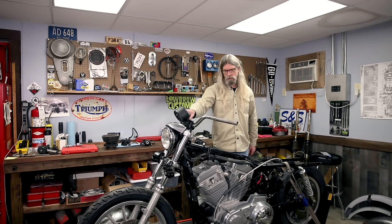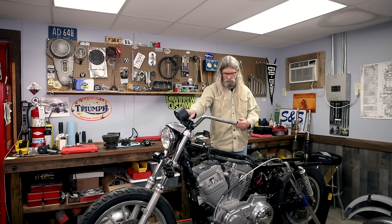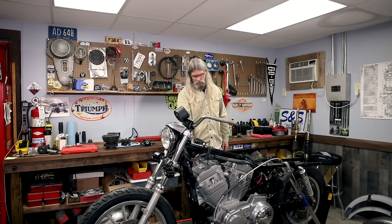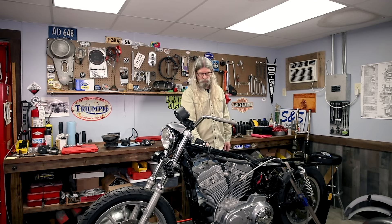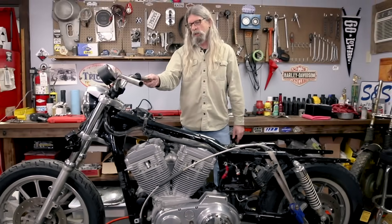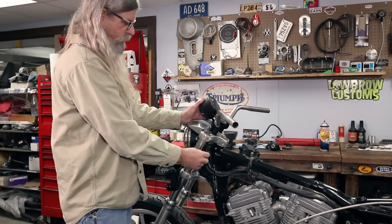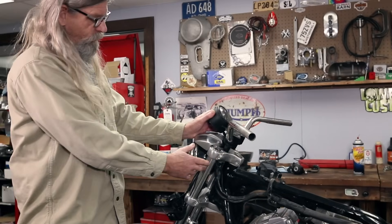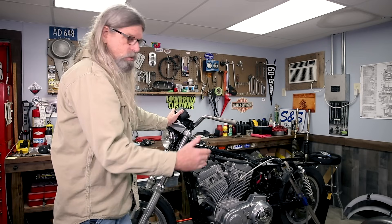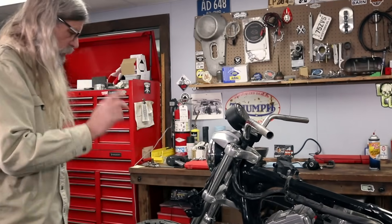You may also notice how I've got the bike on the lift backwards — it's going to make it a lot easier to get this front end off. If you don't have a lift, what you can do is put it on the side stand and using a common floor jack, put the floor jack on the bottom of the frame rail and jack it up until the wheel comes off the ground, just enough to take things apart. You can always block it up with wood after you've got your wheel off. So if you don't have a lift, you can still get these jobs done fairly easily in the garage. The first thing we're going to do before we take the top clamp and the speedo off is loosen the riser bolts. Because if you take the bars off and then try to loosen those large half inch bolts, this part might want to spin on you. So you want to loosen those first.